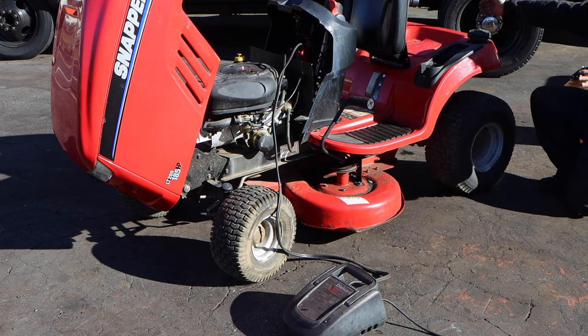This thing has been sitting outside. When I followed the black wire, look what happened. This eyelet. See how rusty, this is not shiny. So I don't know where this goes. This is a ground, but this almost looks like an eyelet for a battery, or if it goes somewhere on the frame. Remember, this bracket is missing on this side, I think. I don't know. So let me hook this up to a ground that I know is a ground.